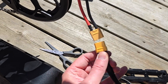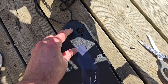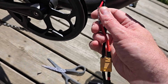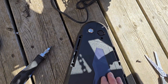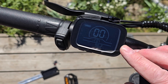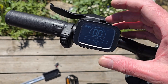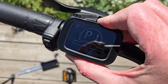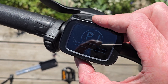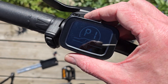I'm going to connect the battery before mounting it on the frame, just to test it all works. To avoid a spark, make sure the battery's turned off first — this battery has a convenient on/off switch. Connect it with the switch off, then turn it on. The bike turns on fine. A lot of controllers can handle a little more voltage: if the bike comes with a 48V battery you can often run it on 52V. In the settings here, this one shows 48V — some bikes have a 60V setting, but this one doesn't, and 48 to 52 should be absolutely fine.